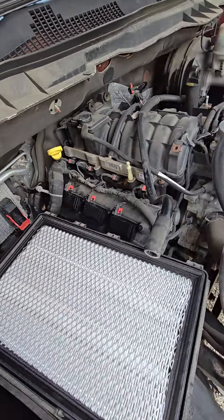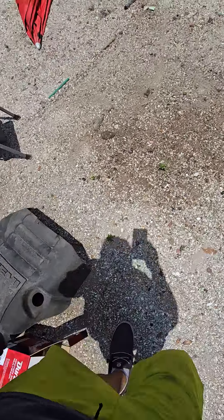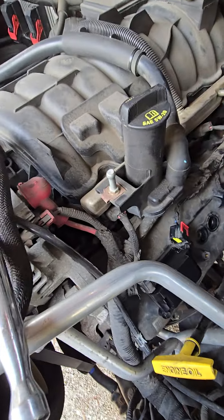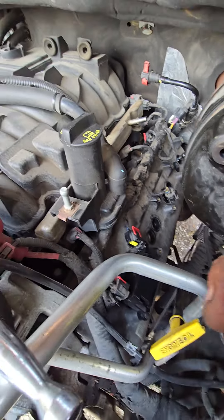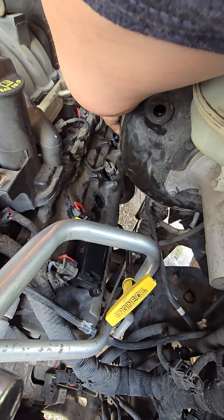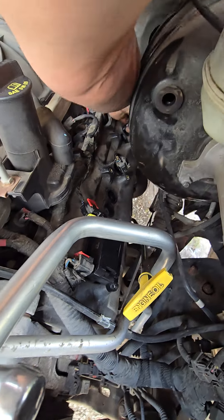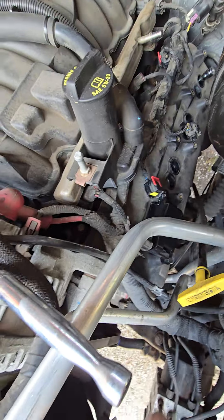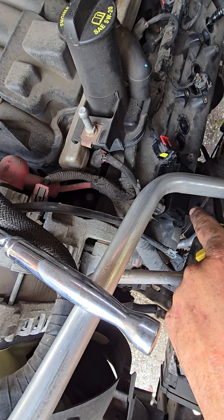This other side — the passenger side — is easy and straightforward, not really painful at all. But the driver's side is a big pain. I've already gotten them all out and I'm tightening the last spark plug back there now, then I'll be putting the ignition coils in. The first one on this side is fully completed — spark plugs tight, ignition coil in and tight.